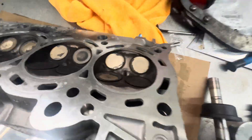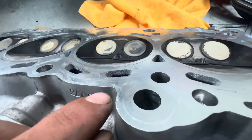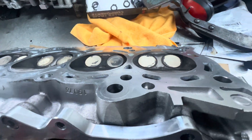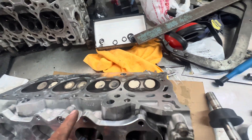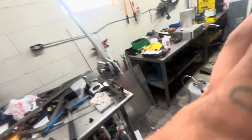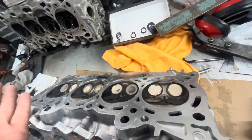Got the head ready to get decked — Andy's going to deck it and we're going to throw it back on. It does have some spots that look like they possibly worked. We checked it with a straight edge but he's going to deck it and gasket-slap this thing back together. We're not going to look at the block because it's possibly got some warpage too. If I can at least get the gasket and head back on and it holds for the rest of the year, I'll be happy — we've got a whole fresh motor being put together as a spare.